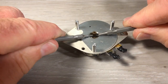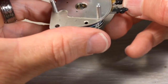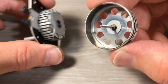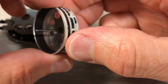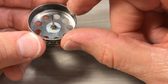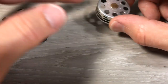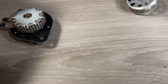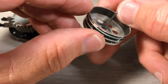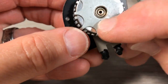There have been some misconceptions — people trying to clean these motors. I did that in the beginning. I thought there might be bearings in there, but all it is is a shaft. That's it — that's what it rotates on. This part here has a strip in there; that's a magnet that's glued in — it's magnetized — and it's just a rod that it spins on. So we have to get oil down to that rod to get this clock working well.